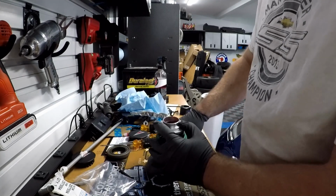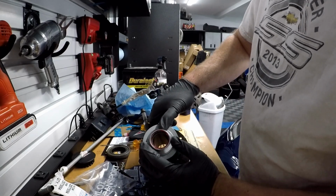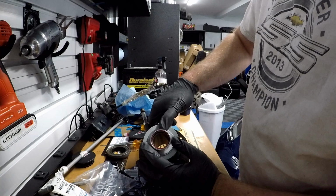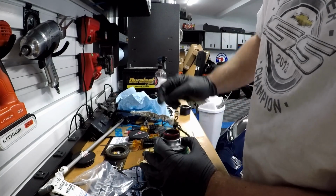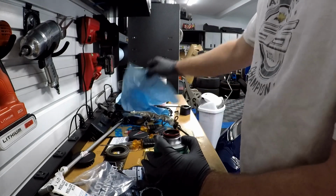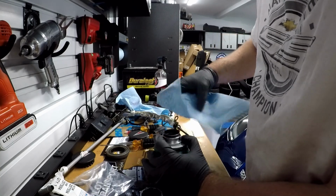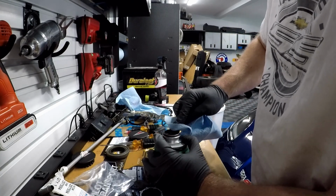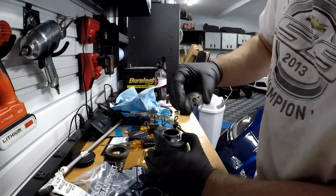Then we'll press down and we'll get the billet bearing inside of the slave, and then you'll see that the grease is kind of coming off on the internal shaft, but that's fine. I'm actually not going to wipe that. Well, I'll wipe off the top. I wasn't going to leave it, but there might be too close tolerances on here. So we lubricated that with grease.